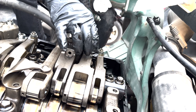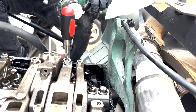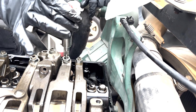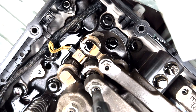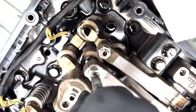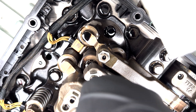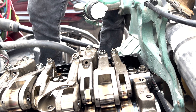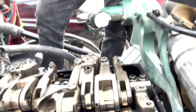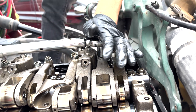For the injector, we're gonna need to loosen it all the way, then with my fingertips tighten it until the end. Now we need to count the flat side four times — one, two, three, four. That will do for our injector — it's 240 degrees, or four flats. Now we tighten to 38 pounds.